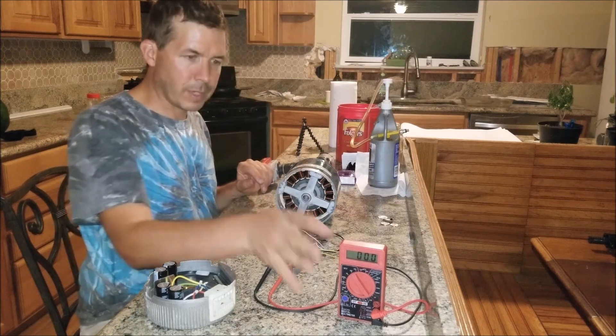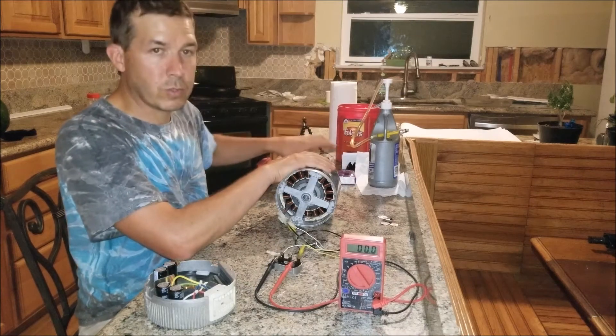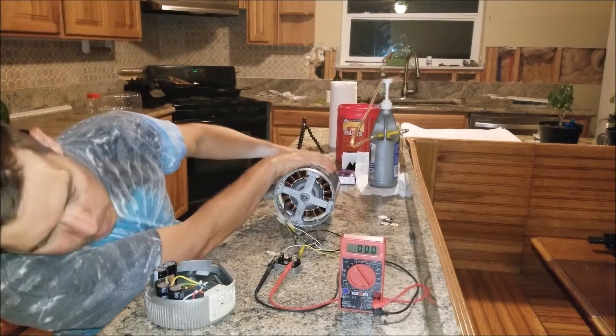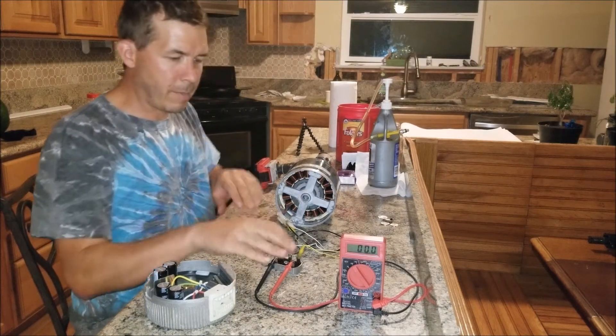To test these I've got a three-phase rectifier — I'll show you that in just a minute. I connect the wires up together, put this in DC mode, and if I just spin it with my drill gun here it should be showing about 40 volts. It's a little over 40 volts there, so obviously it's putting out a good amount of power.